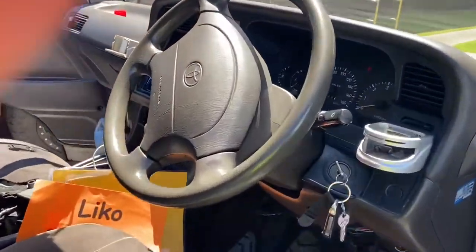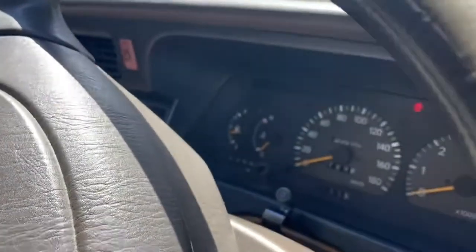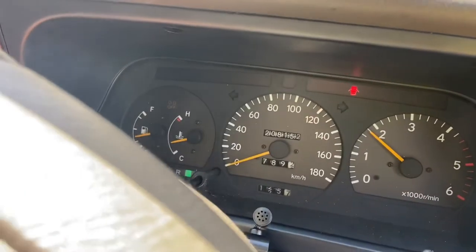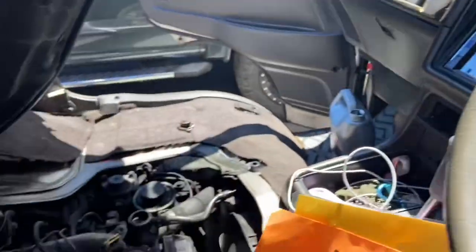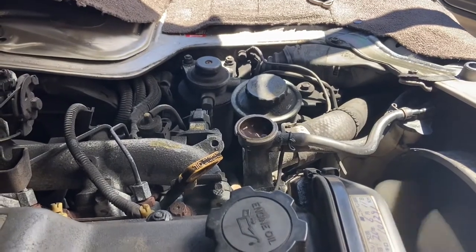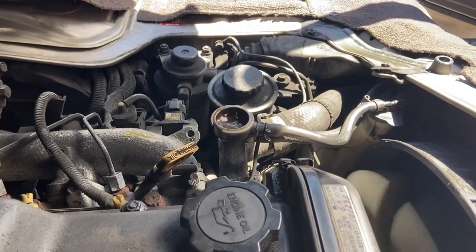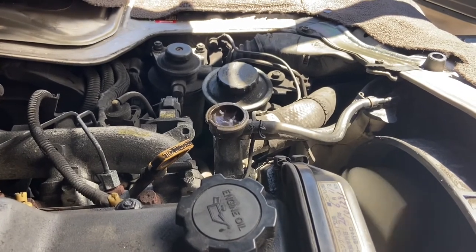Back on the driver's side, cap still off, coolant still at the top. I'm just gonna start it up and see — all the dash lights are still working. Now my coolant light is off, which is good. Don't drive with the engine open like this, but I'm going to hover here until the thermostat opens — hopefully it'll suck more coolant into the engine. Topping off the reservoir will give a little back feed. Should be good to go. Hope this helps!